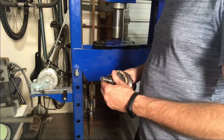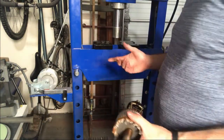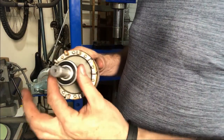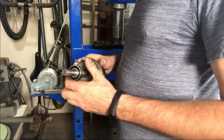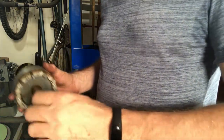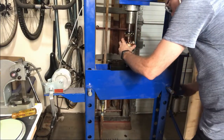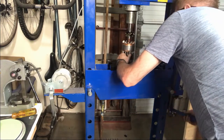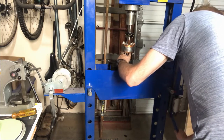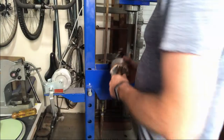I don't have really nice press blocks, but there are a couple of ways to get these bearings pressed back in. If you have a press, use a nice round tube — you want to be pressing against that inner flange. You don't want to press on the outside. I need to find something long — a tube to go in here, probably a piece of pipe that I can cut down. I've got something that we can press against. I've got it positioned level and I'm just going to press it down, then release just a little bit to let things straighten if it's slightly off. I've shouldered it up — you're just shouldering that bearing against the shaft. I've got both new bearings pressed on.